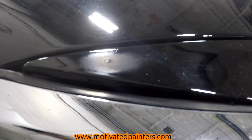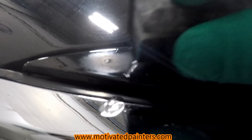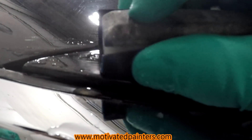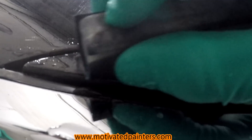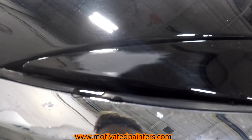Now I'm gonna sand it. I want to get some 800 to give it a quick sand — a little bit of water. What you want to do is lightly sand it, don't go crazy and push down really hard. Just kind of sand the top off. Obviously this is a chip repair so it won't look perfect. Now I'm going to hit it with 1500.